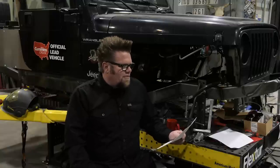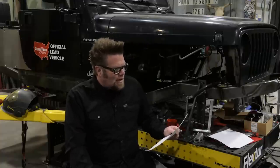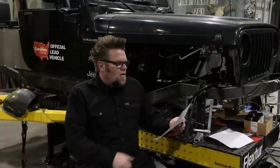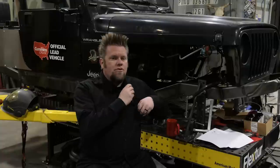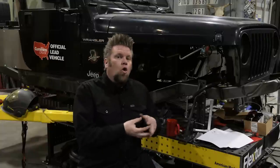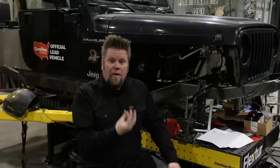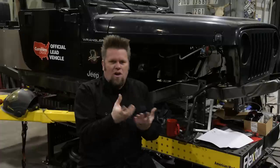From Zsnow7959: Ian, what is your opinion on the Kingpin 60 versus the Super Duty Dana 60 or a custom 14-bolt front axle? That's a really good question. So for those of you that don't know, the Kingpin 60 would be considered like an old school Dana 60 front axle, usually found in leaf spring vehicles, and it had kingpins out of the knuckle — instead of ball joints, it had a large steel pin on top and another steel pin with usually a plastic bushing, which most people replace with a bronze bushing over time.